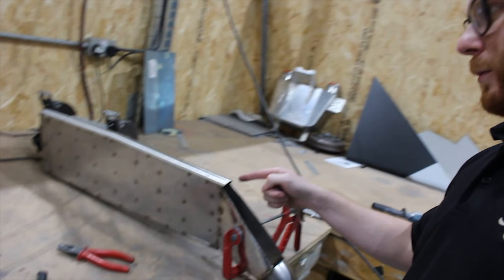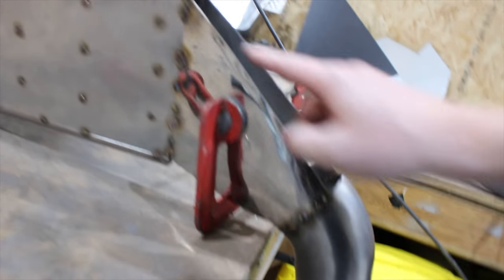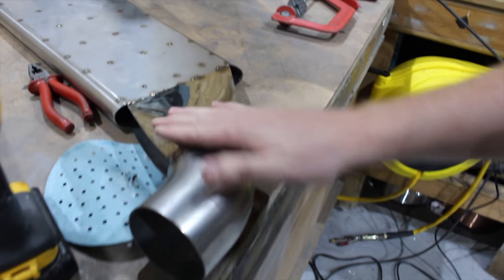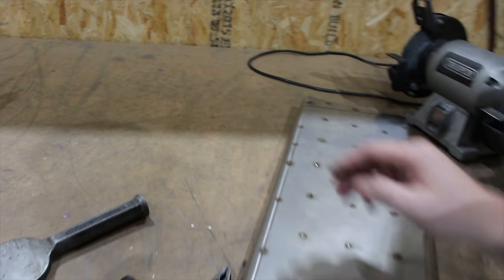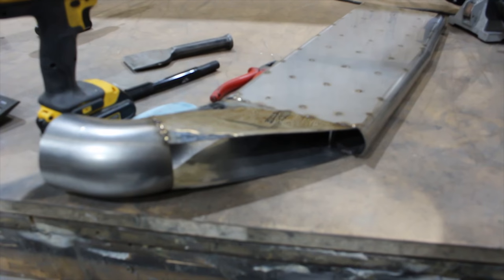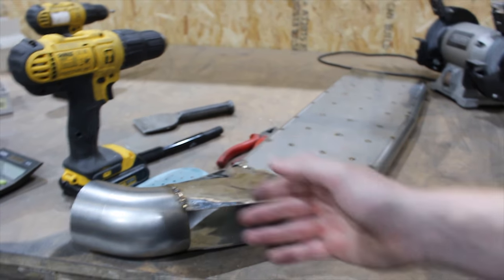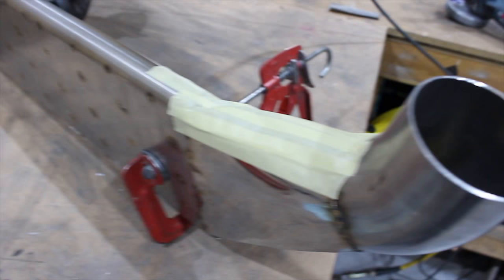Back on the boom tube - I've basically got a 3 inch little 45 degree angle here and I've made up some stainless steel infill pieces to basically bridge the round to the flat. I'm going to have a slight kicked angle, and that's roughly where the edge of the sill is, so I'll end up slash cutting that when it comes out the side underneath the driver's door. I've had to sort of hammer this over a bit and now I need to fill in these side pieces. Looking to use a bit of masking tape over it, draw around it, and then I'll transpose that tape shape onto a piece of stainless steel and hammer it over, roll it a bit, and hopefully it will trim and fill that big hole.